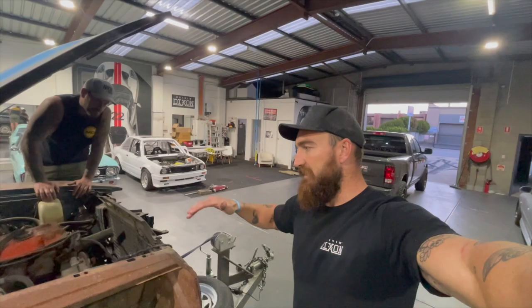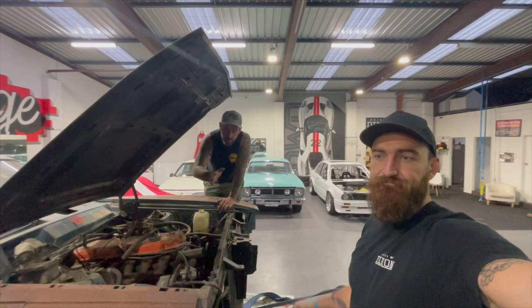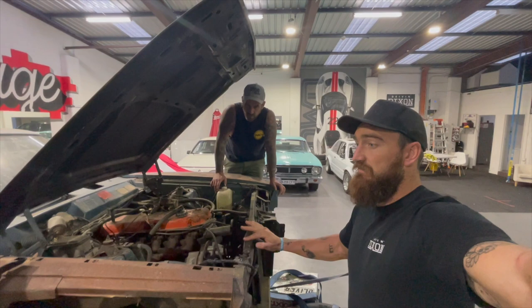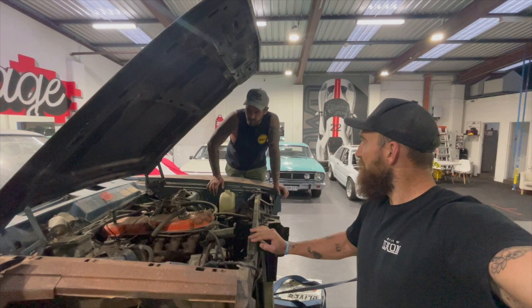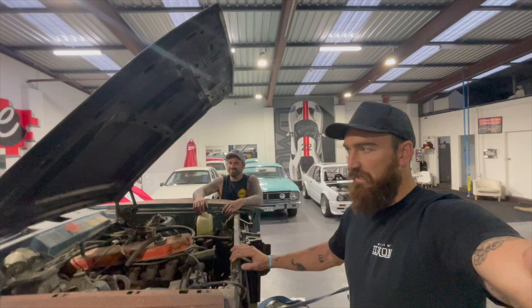We're obviously stoked about this and have spoken to a few SA companies already. We've got Jase from Tough Mounts who's keen to do the engine mounts and possibly trans mounts as well. Speaking with Jase last week, he reckons he already does the big block into a Falcon off the shelf, as well as the trans crossmember mount. For the transmission, we're going to go a C4 possibly — might be going a C4 behind the big block. It's more modifiable, more heavy duty, and more cost effective than going down the route of a Powerglide.